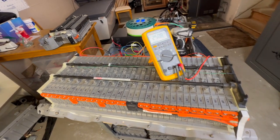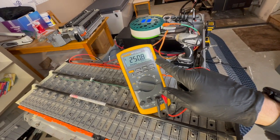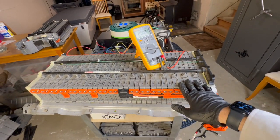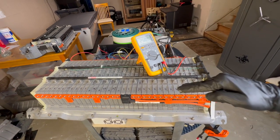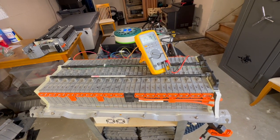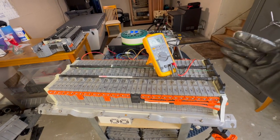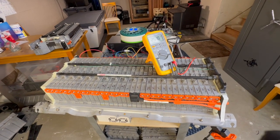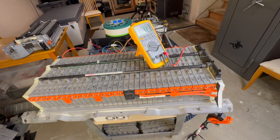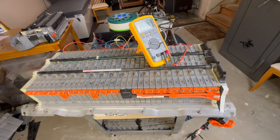I've got to look on the Hybrid Automotive website and read again really quickly what voltage I need to be at for it to go into balance mode. The way I do my reconditioning and balancing is I let it get to its rising voltage, and there's a voltage, on this chart on hybridautomotive.com, where the battery then goes into a balance mode. So I will do a balance, then a discharge, then a charge, balance and discharge. I've had the best results doing it that way. It does take the most time, so if you're very time conscious, you may want to consider not doing that, but all of that's laid out on Hybrid Automotive's website.